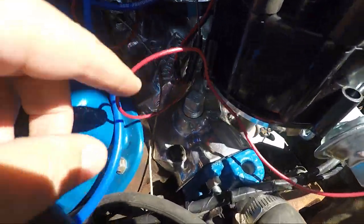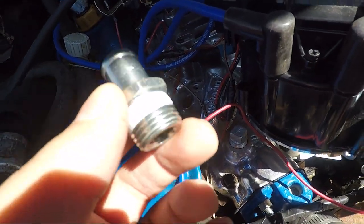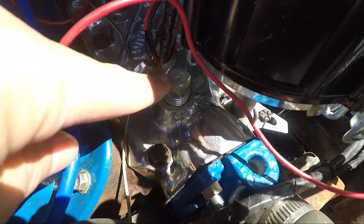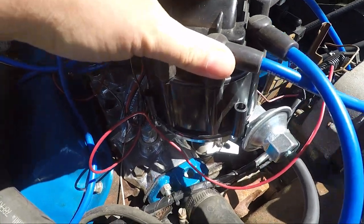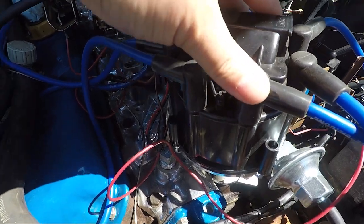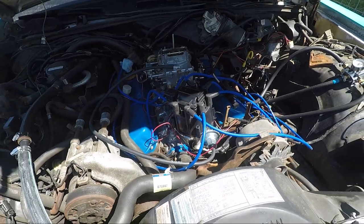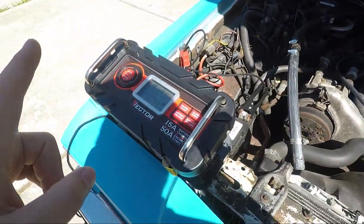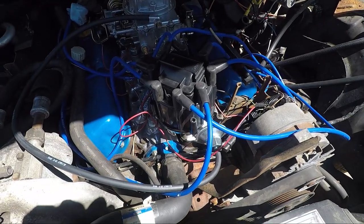What I've done now is I took out the heater hose fitting and just plugged it up so the distributor can turn. I'm thinking that if I can get it to turn enough it'll have a better shot to fire. However, I tried it a few times and it has not worked yet, so I've got my battery charger hooked up there to try and alleviate that issue.